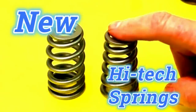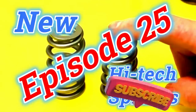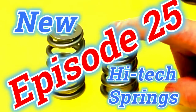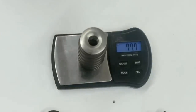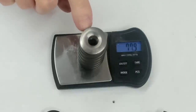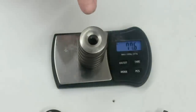If you'd like to know why beehive and conical springs are so much more advanced than regular parallel wound springs, then just go and check out episode 25. I guarantee it will tell you more on this subject than any other internet video. Now, as I said, because these coils up here are smaller and are the ones that take the most motion, this spring acts like it's 67 grams.